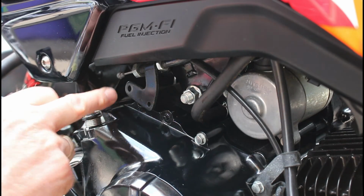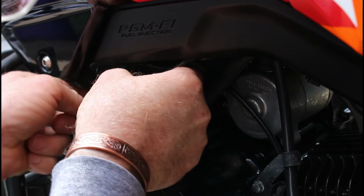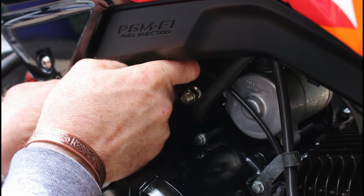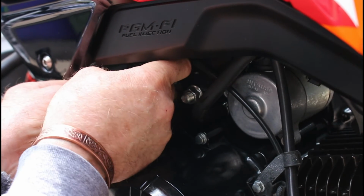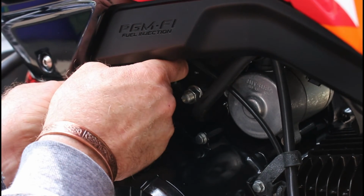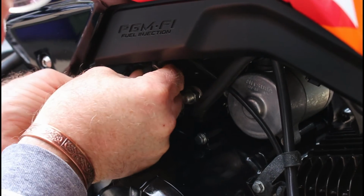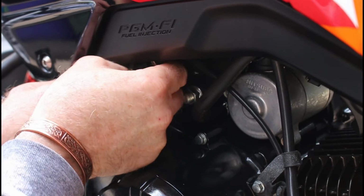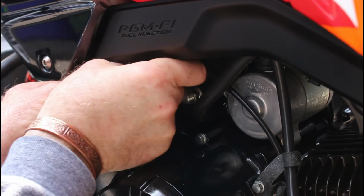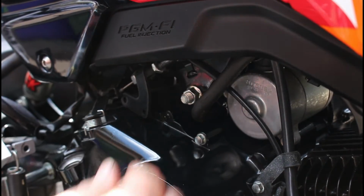And so my last bolt to put in is this one, but this is where we have the clutch bracket, so we need to pull that cable out and we need to engage the cable into that little locator there. It's easier said than done because there's not actually much of a space between the end of the cable and the bit where the cable can pass through into the slot. There we go. That's that in place.